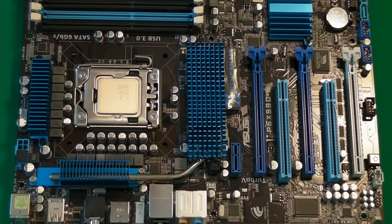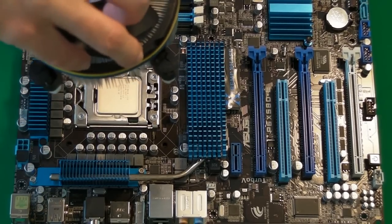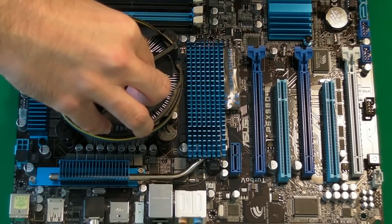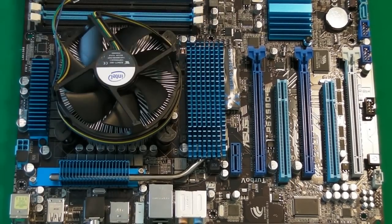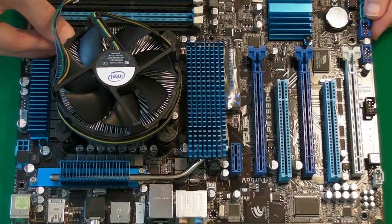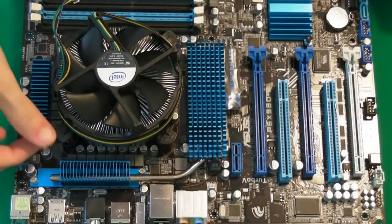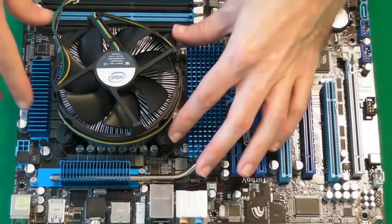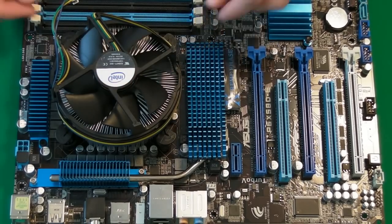Then we're going to put the cooler on. This is the cooler and it's already got thermal paste on it. It's got four locating pins and we're going to put this in position, locating into these holes. That's all of the locator pins in. The instructions tell me to push down on each of the pins in opposing corners. So pin number one first — push down — then number two in the opposing corner, so it clicks. Then number three, then number four. They've all clicked into place. To remove them you need a screwdriver to turn them. That should have locked the cooler and the thermal paste onto the processor.